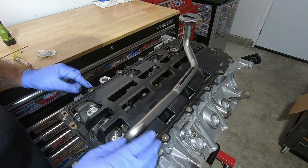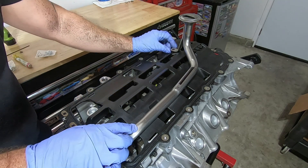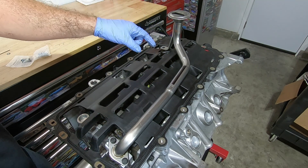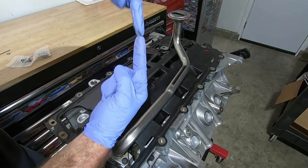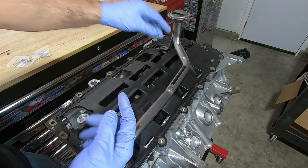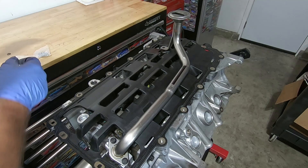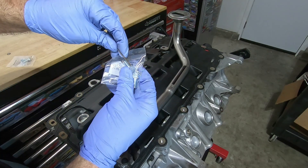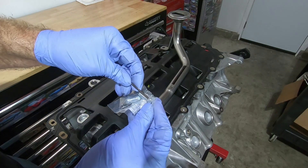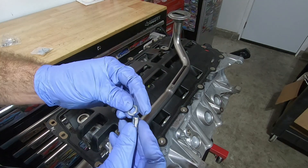I think that's going to work. The problem was it was flattening out and pushing the bolt holes away so they weren't lining up — this looks pretty good. Now I want to determine what length of bolt I need for the little hex spacer. The hex is hollow and threaded all the way through, but there's a stud coming up from the bottom, so you don't want to bottom out your bolt on that stud and have your pickup tube loose. I'm measuring the thread depth and I think this M8 by 1.25 by 20mm is going to be the best bet. I'll put that on with a lock washer.